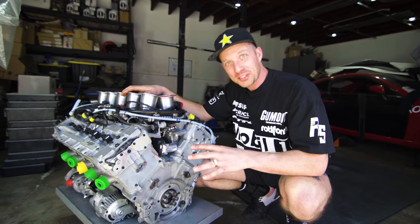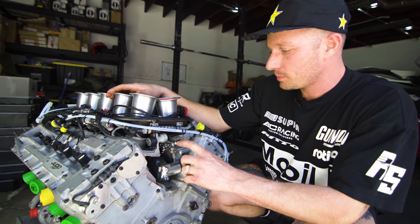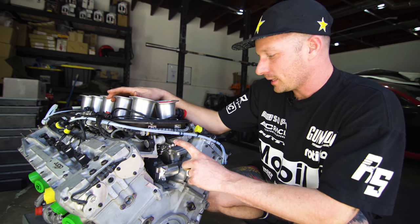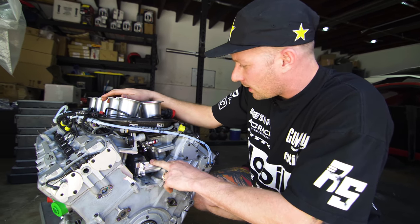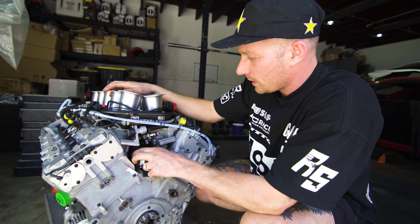Drive-by-wire system is officially finished. So we had to order new rod ends, and Dom had to make some new spacers in here. This basically comes off of the Judd throttle slide linkage and goes to the arm on an EFI Hardware drive-by-wire actuator. And this is fit solid in here, so everything is good.